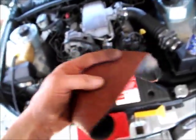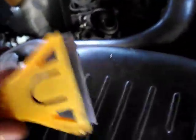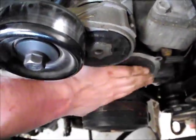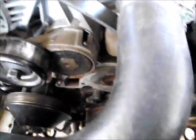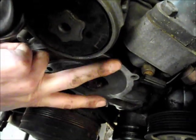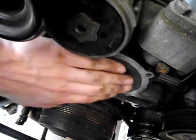Top tip number one. This is 40 grit sandpaper but it's really well worn, so it's not equal to 40 grit — don't go out and get really heavy sandpaper. Worn P40 grit is perfect; it's not that rough anymore. First, get the bits of gasket off there and scrape it off. Then get your sandpaper and very carefully sand it smooth. How clean is clean enough? Well, if you're asking, it's probably not clean enough. You can see it's all nice and shiny — it's got a few pock marks, it won't be mirror finish. You're not aiming to remove material, just to remove enough crap for it to be smooth and clean.